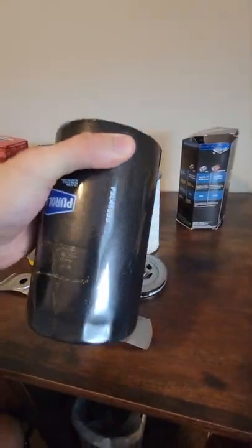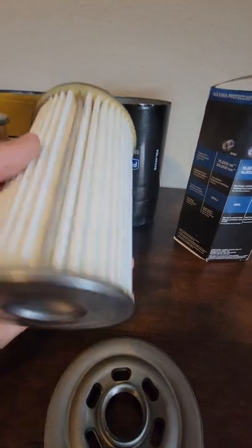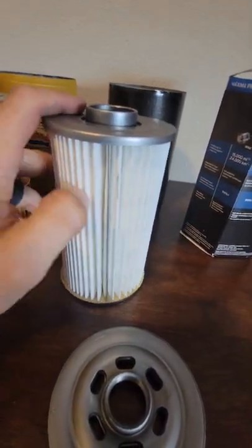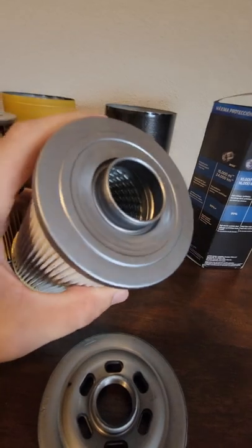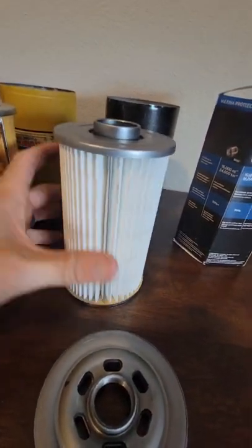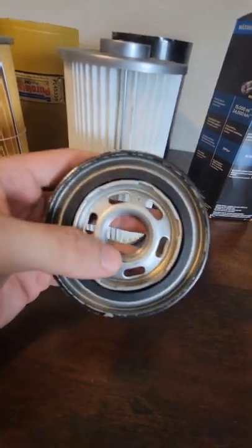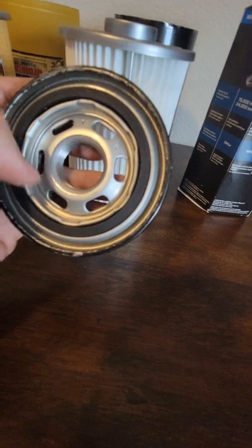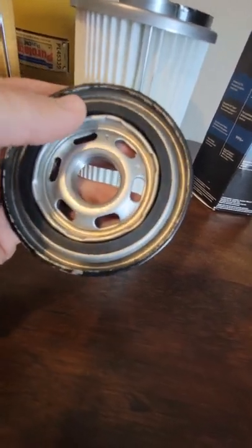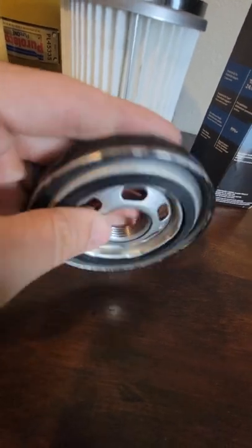The Boss casing is obviously the thickest, just like they always claim — it is thicker than the other ones, and still has great flexibility and rigidity. The filter on this one is completely synthetic, and I'm a fan of buying full synthetic filters since they're the best at trapping everything. The quality control on this one is obviously the best of the three — they got rid of the sketchy string. No complaints with the filter; it looks great. Moving on to the top end: they went back to a black gasket over the red gasket. And the oil intake holes are like oval rectangles — basically oval — which is something I've never seen before on an oil filter and found kind of intriguing.